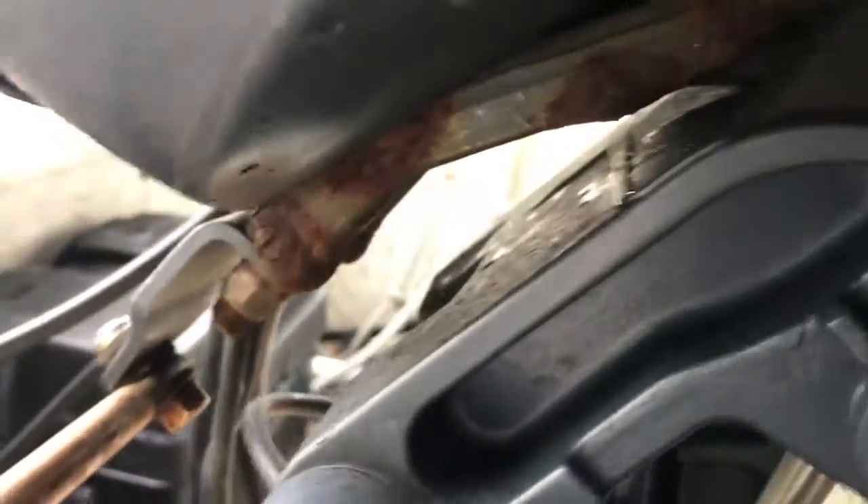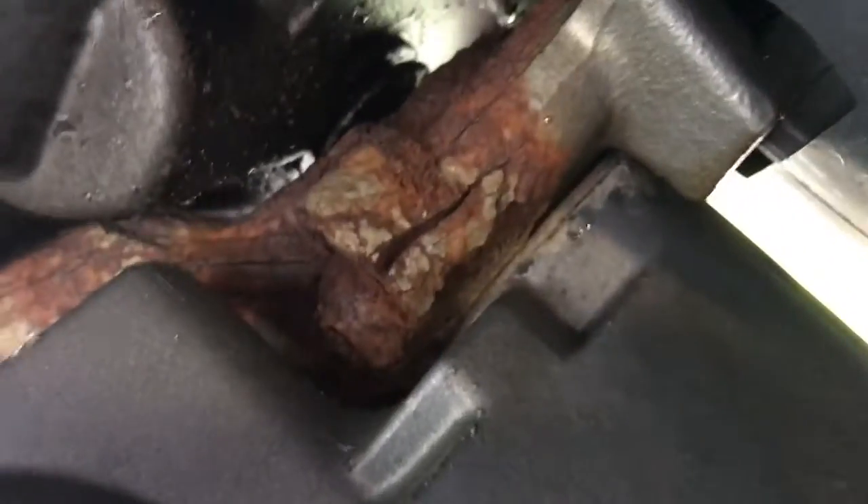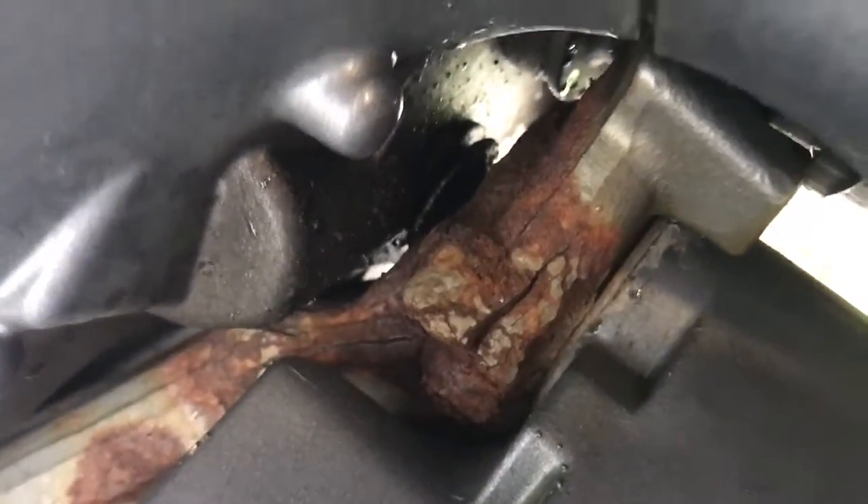This right here is my main concern. This arm is pretty well corroded — that is the top of the kingpin bracket on the motor side. It's not the spinny part, so I don't think that's going to be our problem, although if there's rust there, there may be rust lower. That's the top of the bracket; down here is the bottom of the bracket.